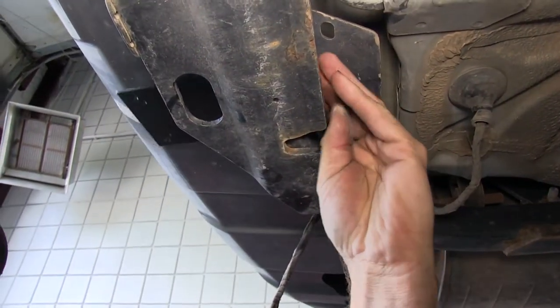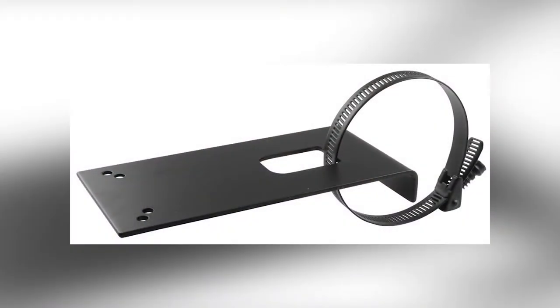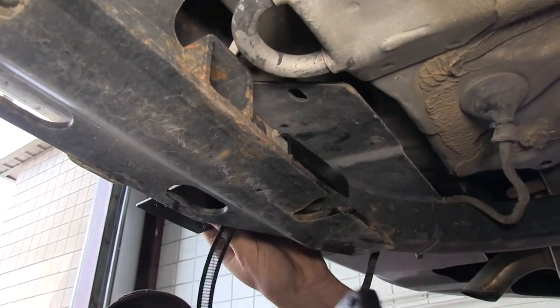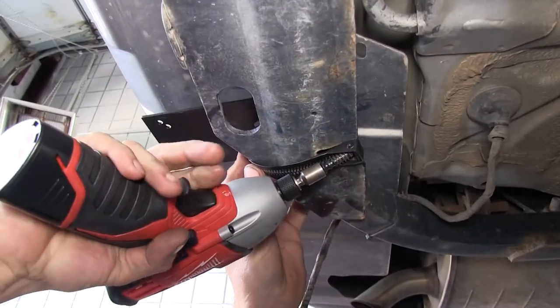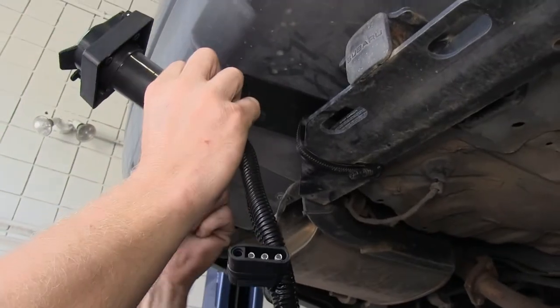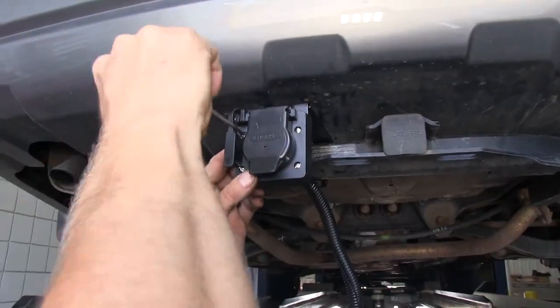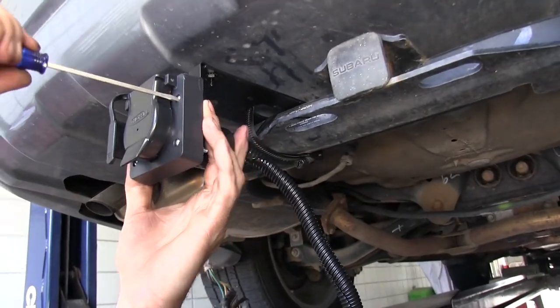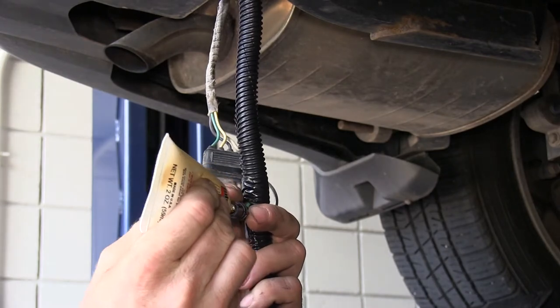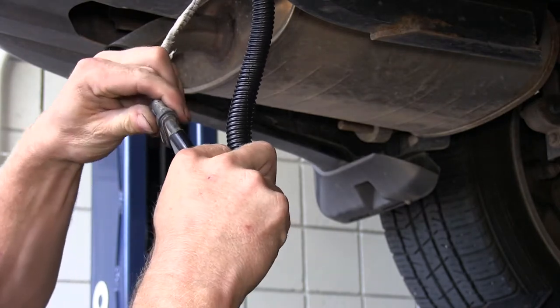We're also going to need another part to connect our 7-pole bracket to the hitch — that'll be part number 28136 from Tow Ready. We clamp this to the hitch. With the bracket in place, we'll go ahead and add our 7-to-4-pole adapter and bolt it in place. Then we'll connect the two 4-pole ends together, add some dielectric grease to help protect the contacts, and tape it together and use a zip tie to make a permanent connection.